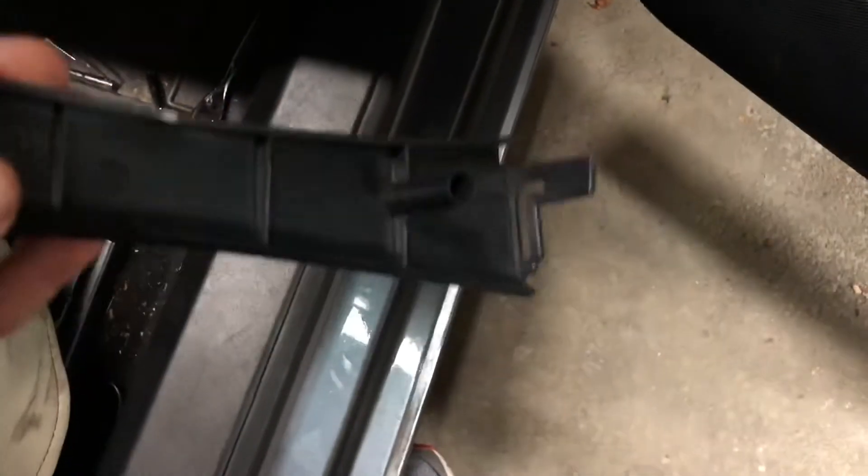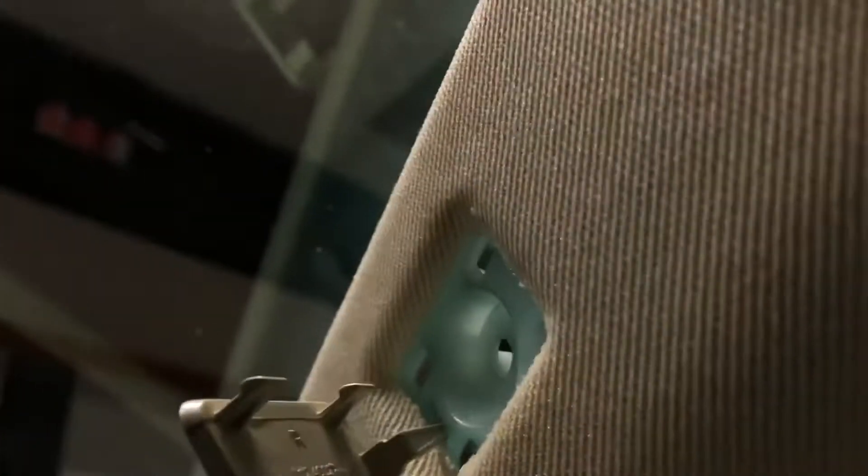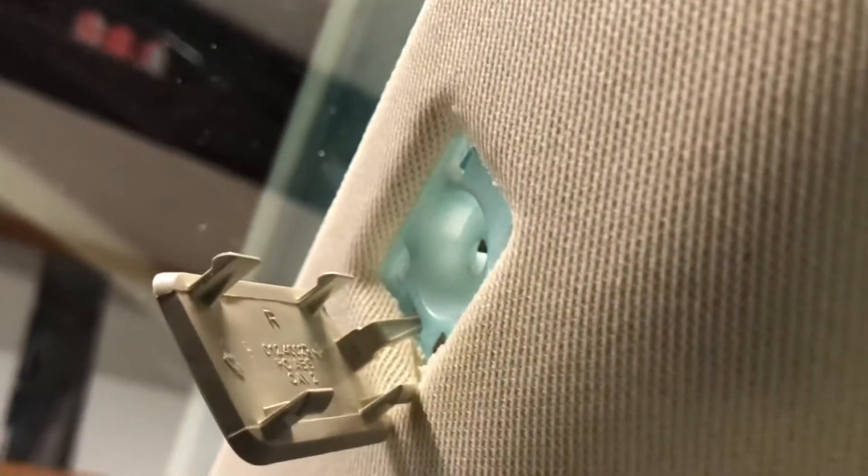I just have that sitting on the glove box because it's handy. And then there was this piece of trim, which isn't actually held on by anything — it just kind of sets in there. And then there is a seven millimeter screw which hides behind that little door, and then that pulls out. This is supposed to just lift straight up, but I'm having a little trouble with it.